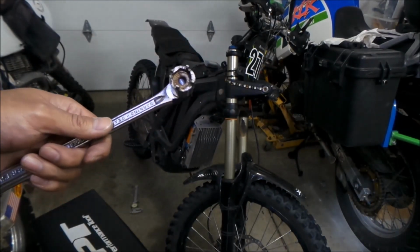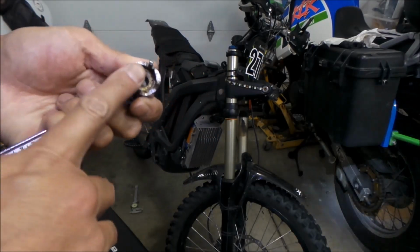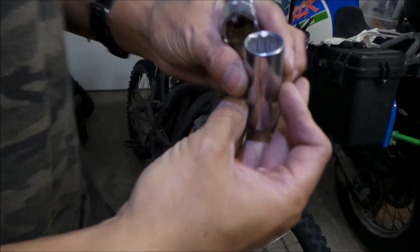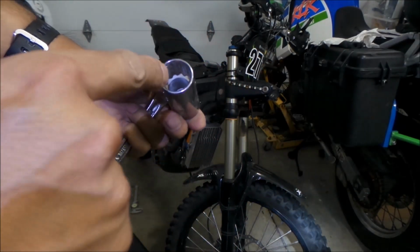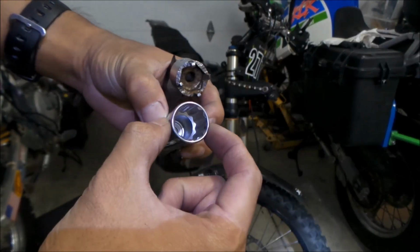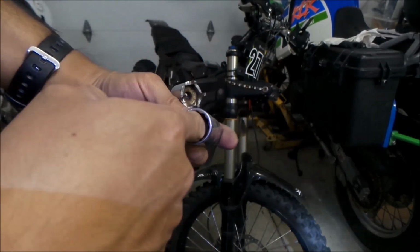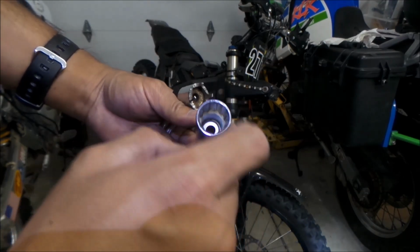It's probably better if you had a pipe or something, or you know what would be better? If you use a long one, if you use a deep socket. Let me see, I got one. Actually, I think if you use a deep socket, it'd probably be even better. Because look, in the deep socket, it's more solid down here. So if you just cut the splines off of this 12 point here, you'll have a nice round socket right there. And then you can use that to cut.